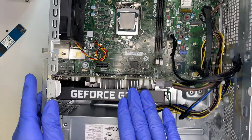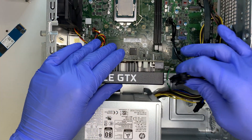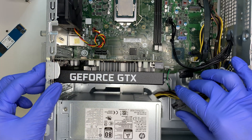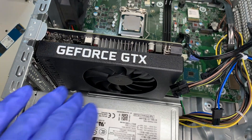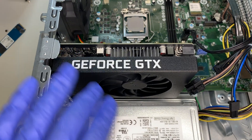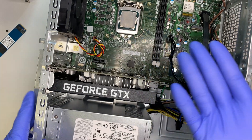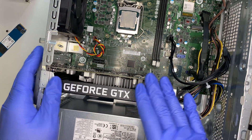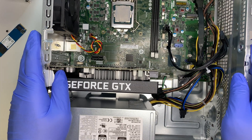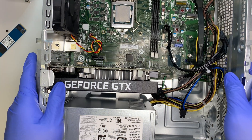This is the graphics card here — it's a 1650. Let me remove the pin: this is a six-pin connector for this graphics card. This graphics card is pretty standard — not proprietary — it's an EVGA or NVIDIA card. It's a fairly generic graphics card; it'll get the job done and let you play games, though I'm not 100% sure about the FPS, but the 1650 is pretty decent.